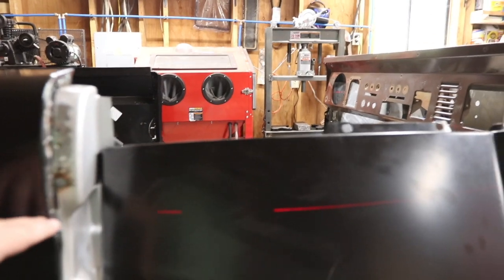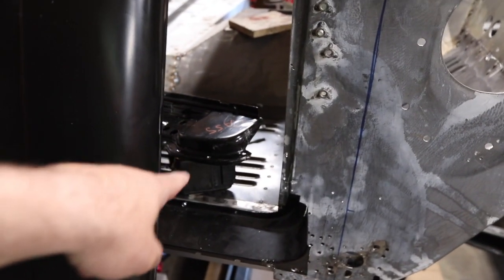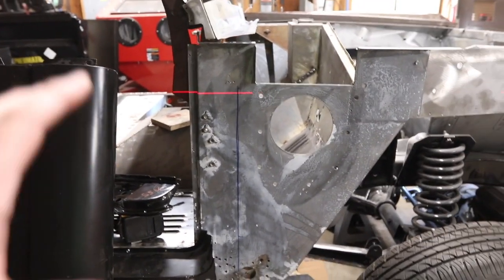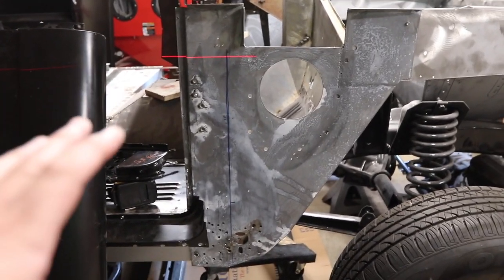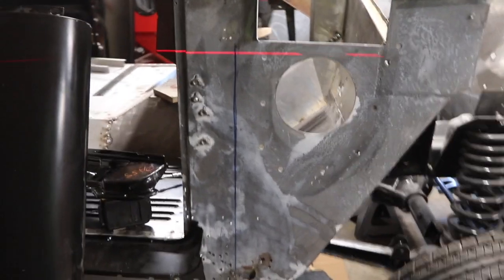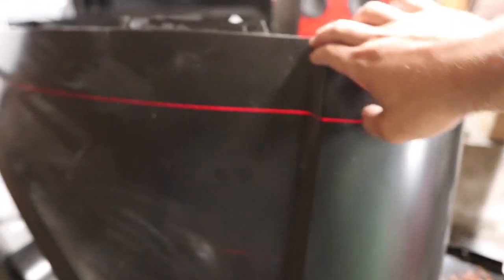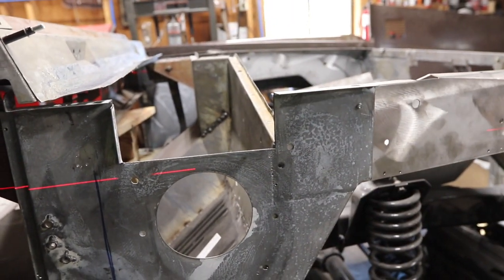Second, the door would angle up here no matter what, because I've got this loose right now so I can adjust it, and I broke apart my front A-pillar so I can adjust it and angle it per my last episode. Okay, great. So I did that, and then when I could get this side of the front fender, meaning this line here, imagine the front fender's mounted, lined up on the laser, the nose kicked up like crazy, like a full inch.